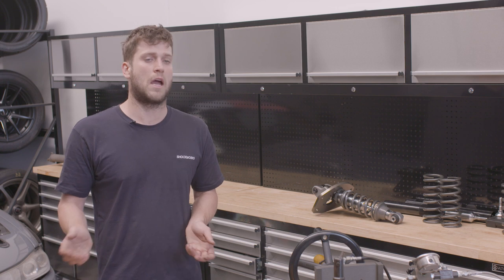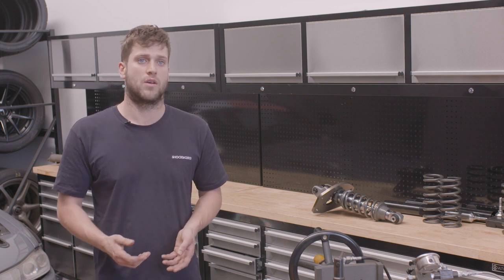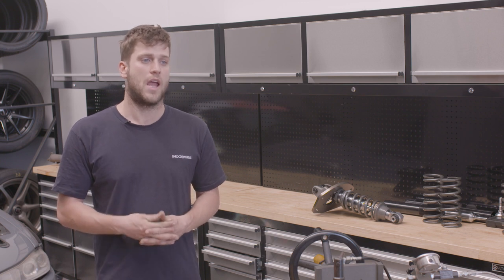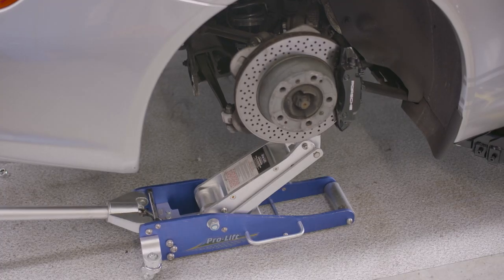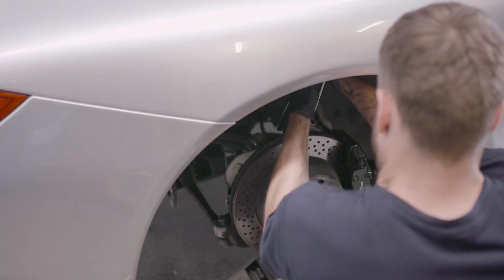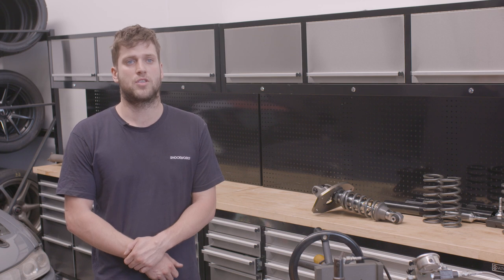I've driven $8,000 coilovers that felt terrible because someone put too much spring preload and set the shock length too short. It's very crucial to have a solid understanding of how to set up the travel of a car properly and make sure it's sitting in the middle of its travel. Once the coilovers are in, always make sure all bushes and mounting points that are on a travelling arc are torqued at ride height — this is always recommended because these bushes store energy, and improper torquing increases NVH and shortens the bush's life.